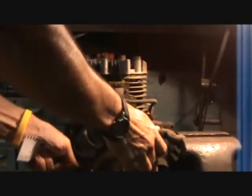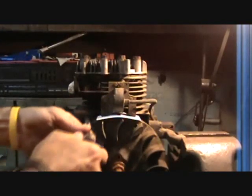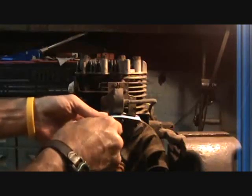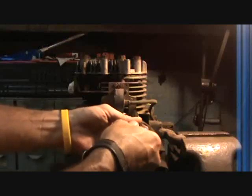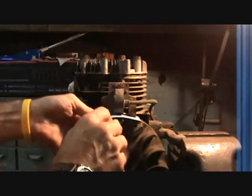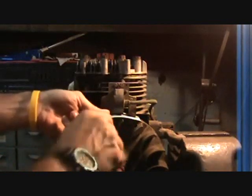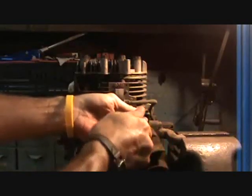I've got my bolts just a little too tight, but I can push it down. I'm going to loosen them up so you'll see that it will self-level itself. See how that dropped when I loosen each side? Now just tighten up these two bolts. Don't tighten them too tight — it's a steel bolt going into aluminum, and aluminum does not like to be over-tightened. You do not have to over-tighten these.